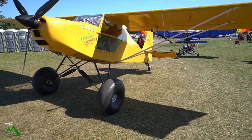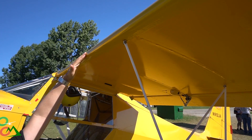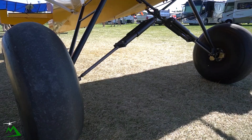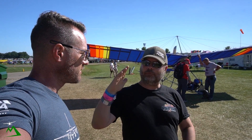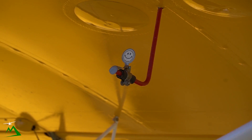This is a 2012 Highlander, and what I've done to make it more capable is I've added a leading edge slat on the front wing. That gives it even more camber so I can land in about 150 feet, maybe less, single pilot. When landing in really rough terrain at a higher angle of attack, I've added really tall landing gear from Tony at TK1, with his shocks, so you come in really slow with very little horizontal movement and then drop it on a steep approach — which is what I normally prefer off-airport.